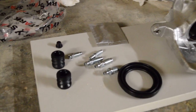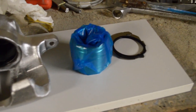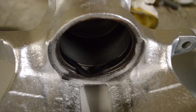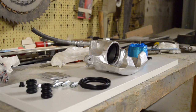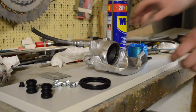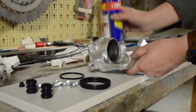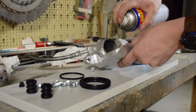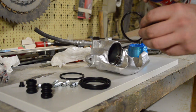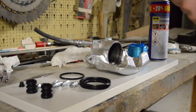These are all the new parts I ordered for these brake calipers: new piston, new boot, new inner seal, and new nipples. I also got some new sliders — those came in when I ordered the caliper carriers, so those will be replaced as well, as well as the rubber boots you can see here on screen. I first lubed everything with WD-40 before installing, so the piston will go in more easily.